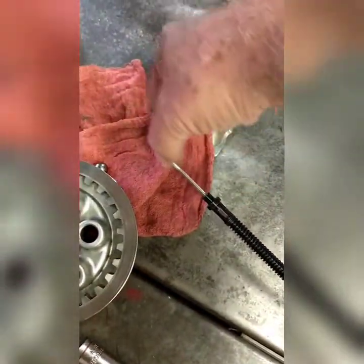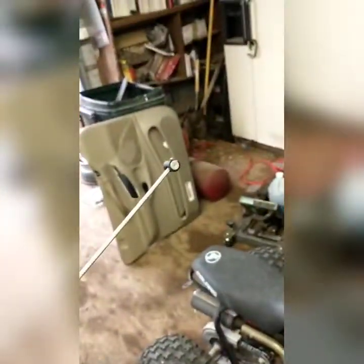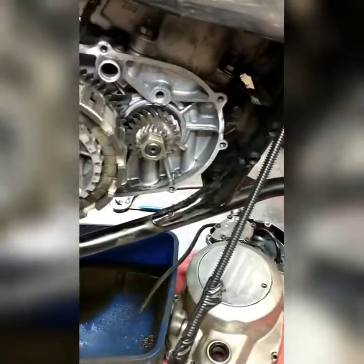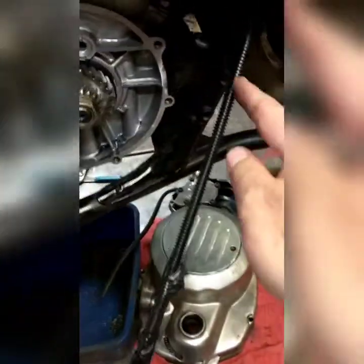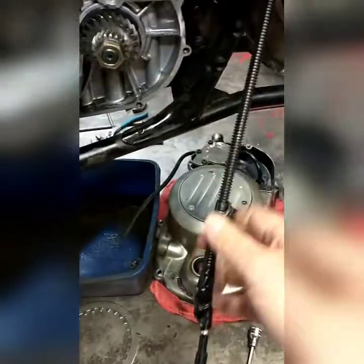How free should it be? The cable is just laying here, you can move it very easily. A new cable has like zero resistance. Here's the new cable - out here goes up to the handlebars, the part that goes down I taped right here to the old cable. That way I don't have to worry about threading it and monkeying around. I've got the old cable out here, I can just pull it and work it. The new cable is already all threaded through there for me.